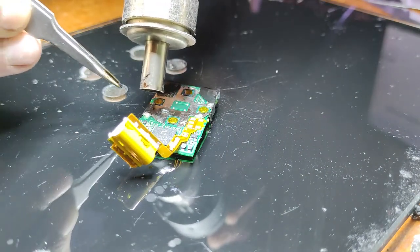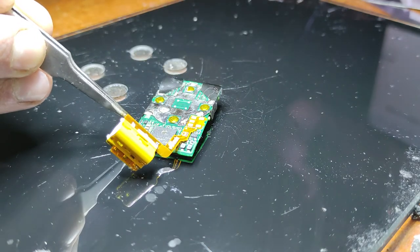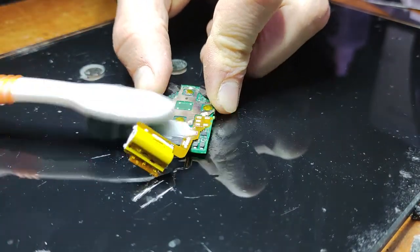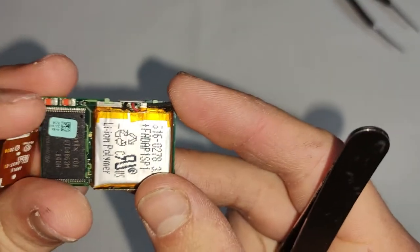You just need to get another one, obviously, which you can poach from other iPods a lot of the time, because a lot of other dead iPods will just have random coils on them. Well, that's what I do if it breaks most of the time for me. I've had to do that maybe 10 or 20 times, and I've repaired quite a few of these now. So, just removing that battery.